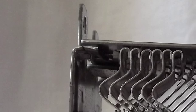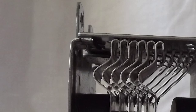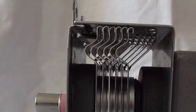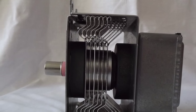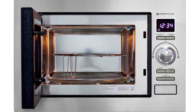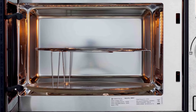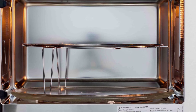Another way it can kill the magnetron of your microwave is when enough of the generated microwaves don't get absorbed, such as if the food is wrapped in aluminum foil or mostly enclosed in a metal container, or if you just run the microwave empty for long enough. On a more mundane level, something like a spoon or metal plate, positioned correctly, will simply make your food potentially not cook normally. Once again, it is actually acceptable to put metal in a microwave under the proper conditions. Some microwaves even have metal grates inside them for setting food on, such is often the case with certain convection ovens. There are also certain types of metal pots and pans that are microwave safe.